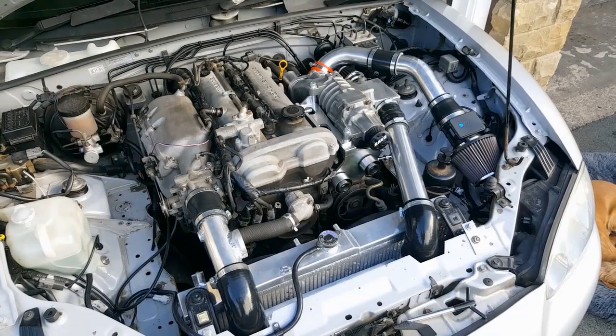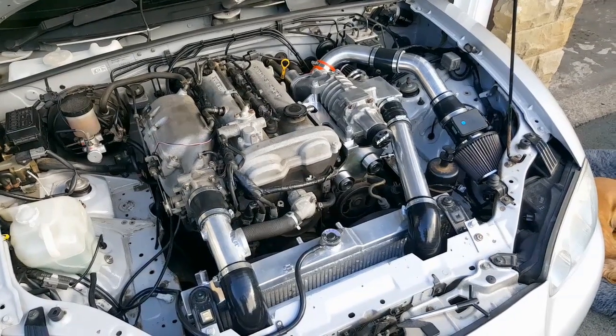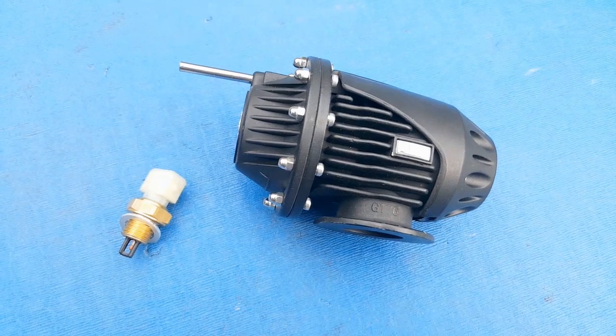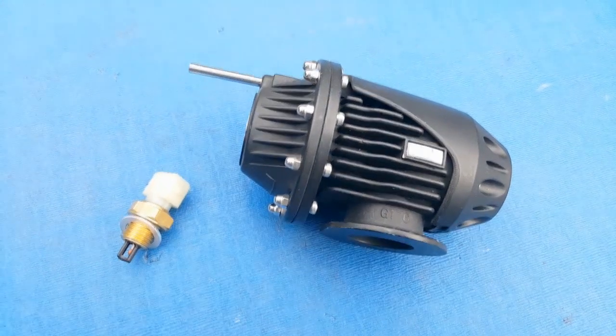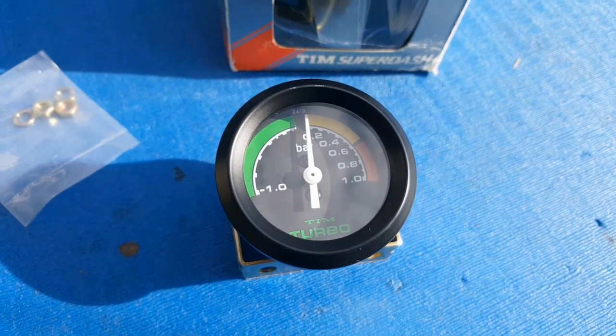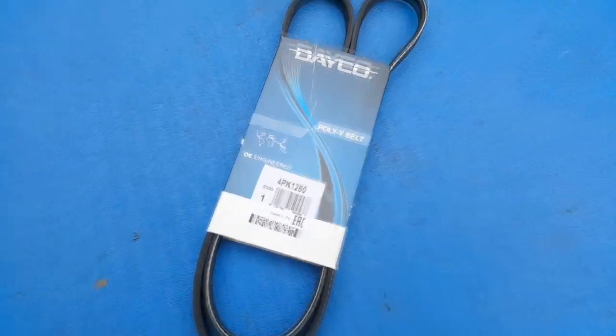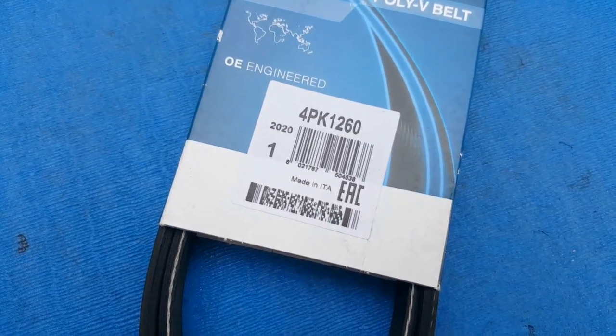That's the intake piping taken care of, and we are so close to finishing this build now. In the next episode I need to get the blow-off valve installed, the inlet air temperature sensor installed, and the boost gauge installed. After that I just need to get a belt on it, because the 1260 belt supplied in the G19 kit is too long since I've used a Cavs reduction pulley, so I just need to figure out the correct length. If you want to stay up to date with this build and see its conclusion, don't forget to subscribe to the channel, and if you enjoyed the video please give it a thumbs up.